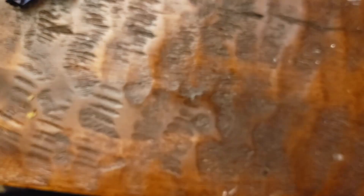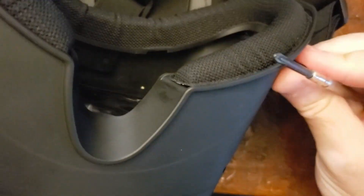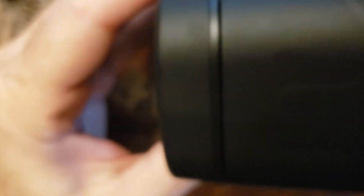I'm going to break this down. Fortunately there are four screws on the outside, a clamshell with a pop, four screws on the inside, and it just comes right apart. To start, there are four easily found screws along the case itself and they just require a very small Phillips screwdriver. These are screws directly into plastic — not Loctited or anything — but they are very tight because they're just threaded into plastic. So just push in really hard and twist. Pull out the telescoping piece and you'll notice there's a clamshell holding it in.